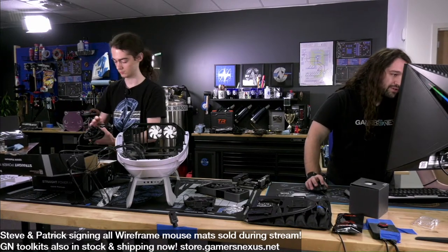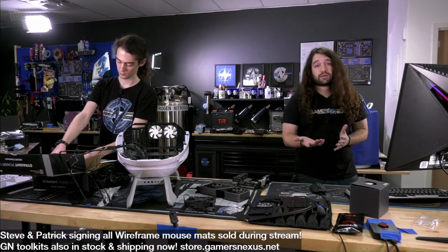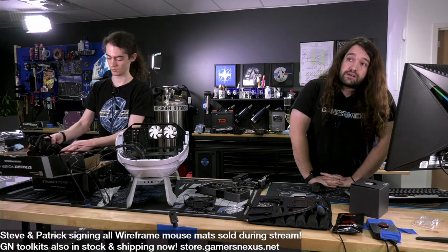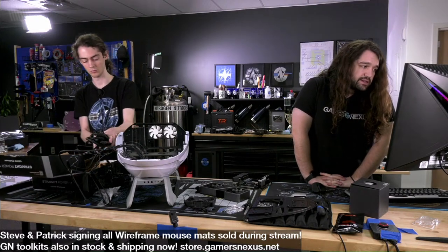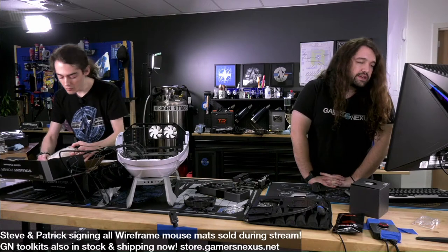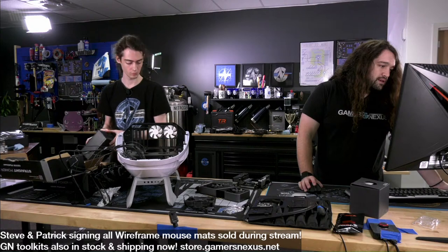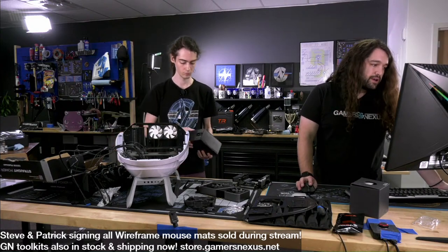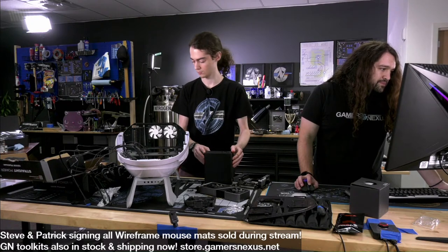As for the question about the Kraken G12, I've looked into it, and back when the first one came out, I don't know if it's G10 or 11, but we did work with it. And it's not bad. It's a little finicky with anything past the 10 series. I've had mixed success, mostly not success, with getting it to really fit properly. But there aren't many options these days to sort of hybridize your video card if you buy an air-cooled one. You get a couple more of these.